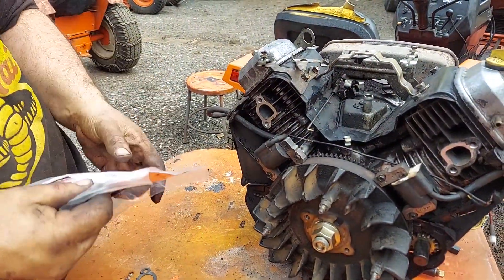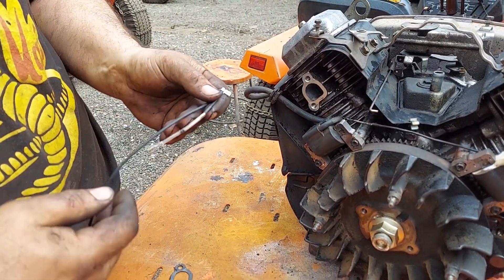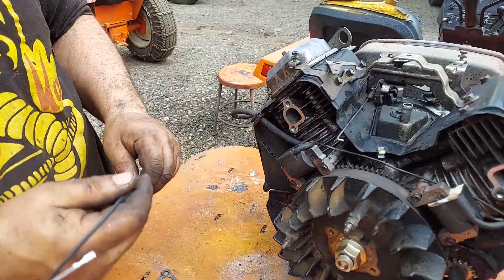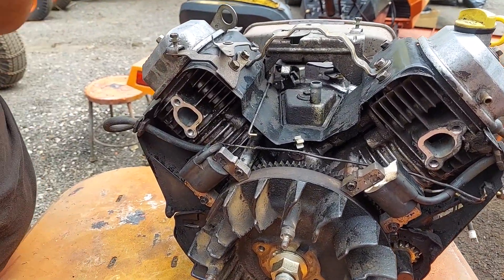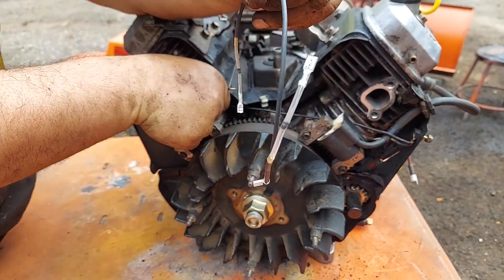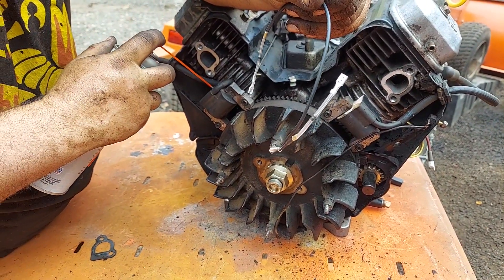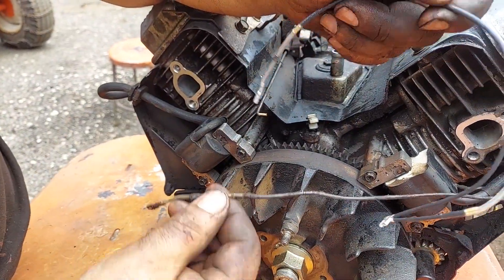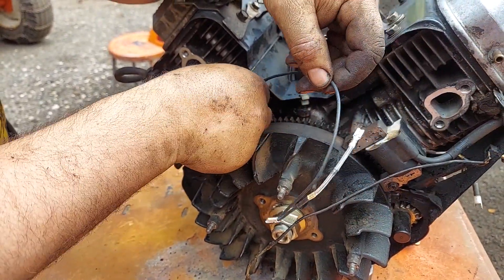Pay attention on this — it's got a diode, so it's basically an electrical check valve. It only allows electricity to flow one way. So this has to be hooked up correctly. When you're taking the old one off, just do the same thing. We've had people hook these up the wrong way and things get messed up — the tractor won't run, won't start, won't shut off. Clean the contact with contact cleaner or brake parts cleaner, whatever you got handy.